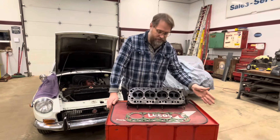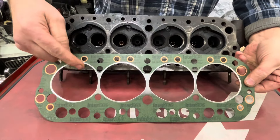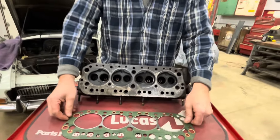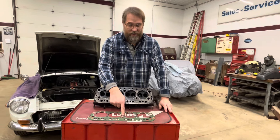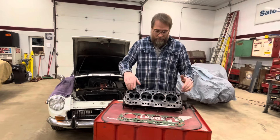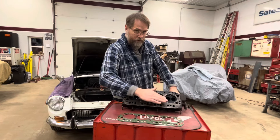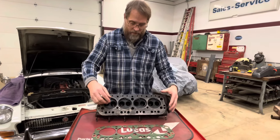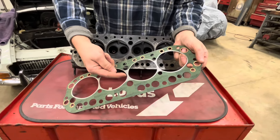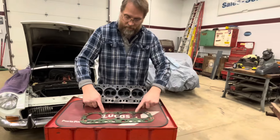Looking at a cylinder head and head gasket, you'd think it'd be more likely to blow between one and two or three and four than between two and three — but these engines are actually more likely to blow between two and three. The reason is these heads warp, and you pretty much never take one of these cylinder heads off without measuring a noticeable amount of warpage. If the head warps enough, it puts less clamping pressure on the center, so compression starts bleeding back and forth and burns it out — much more prominent between the center two cylinders.